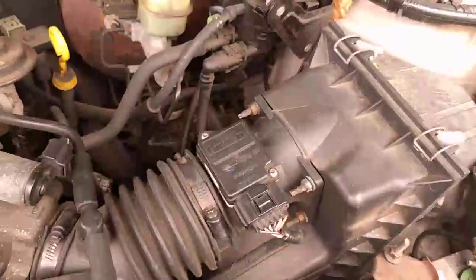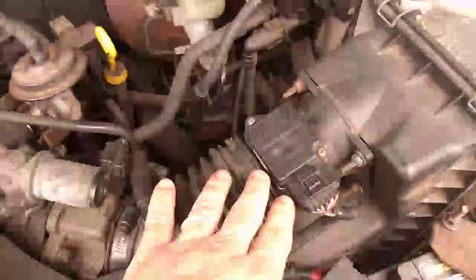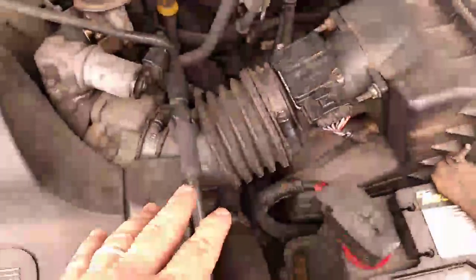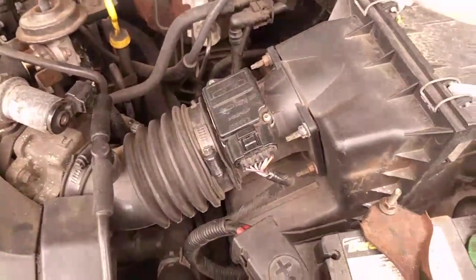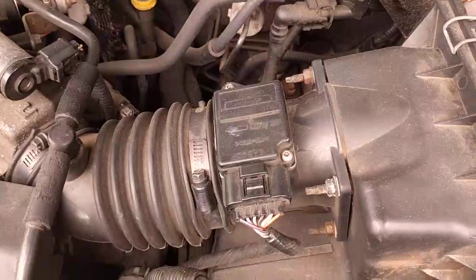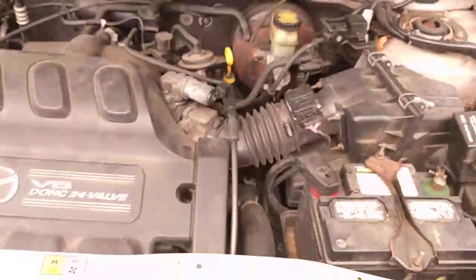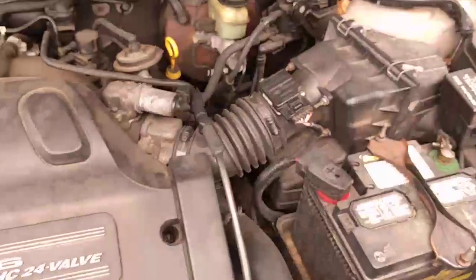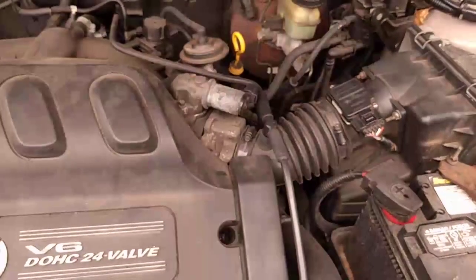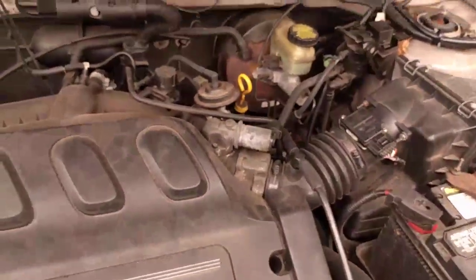If you can isolate circuit issues and they're fine, if you have no breakage, no intake leaks, and no fuel trim codes concurrently, then it's safe to say that you have a problem with the sensor itself, in which case you'd probably be okay replacing it. So that's again taking a look at DTC P0101 and ideas on what could be the cause. We'll come back another day with another video on fixing your car. Have a good day.